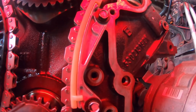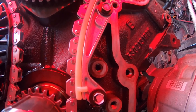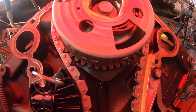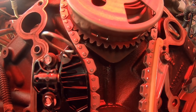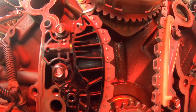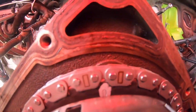Welcome back. We've got our new metal guide in — the old one that came off was plastic. The tensioner is in but we're not releasing its tension yet. Waiting until we've verified smooth operation with cylinder heads and push rods installed, then we'll torque it, pull the pin to apply tension, and put the timing cover on last. The timing marks are still confirmed in position.